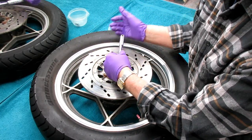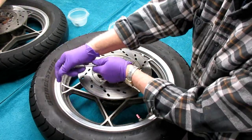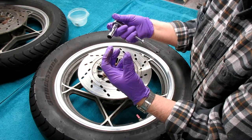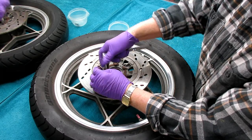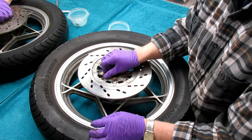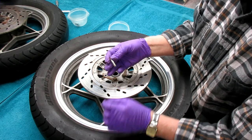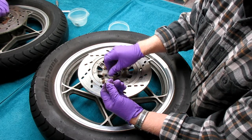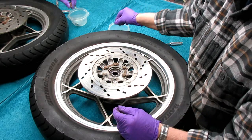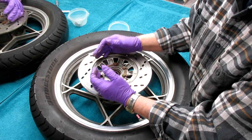Back in the day a lot of people had heavy hands. On the R1 wheels and FZR wheels, getting out the Yamaha bolts that came with red loctite was an absolute nightmare — you'd usually booger them up or half-strip them. I went to a motorcycle mall to get authentic Yamaha replacement bolts, and the guy told me an awful lot of people come in to buy replacement bolts. The technology today is they red-loctite them in. What Scott did was cute — he painted these little tangs to match the bike. We're not going to use these bolts over again. Just accept from the beginning: it's going to be a long job with a lot of steps, and if you do it right you're way ahead at the end.